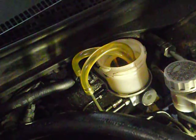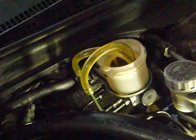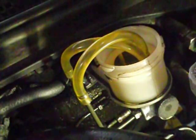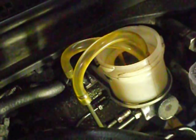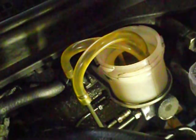A lot of videos show you to remove it and manually do it, but this way I had some extra fittings — I had bought new ones. You can see here in the front, which are the M10 by 1s. I took them from the old ones and made my own bubble flare fitting on a 90, connected the hose, fed it back into the canister or the reservoir, and it started pumping and got rid of lots of air. In this way it brings fluid back in and back out again, and the air bubbles float to the top — that's how you get rid of the air in the master cylinder.